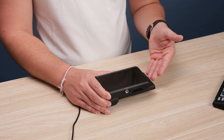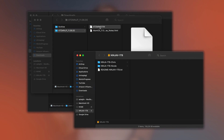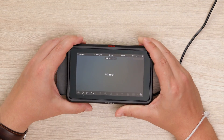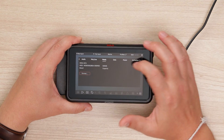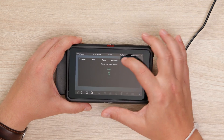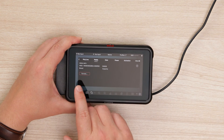If you find that your Atomos device does not find the firmware upgrade — either while it's turned on and you slot in media with the firmware on it, or if you're trying to boot from media with the firmware and it doesn't recognize it — then I would recommend two things. First, make sure that you are placing the correct file onto the drive. Second, make sure that your media is formatted in a way that your Atomos device is capable of reading. The easiest way to do this is to turn on your Atomos device, insert the media, and go to the SSD storage area in the settings. Go into settings and scroll to the end — there's a point called Media and there you will find a point called Format. When you do the formatting in the Atomos device, you'll have media formatted in a way that is understandable for both your computer and the Atomos device.